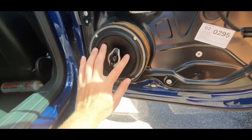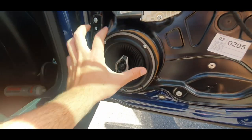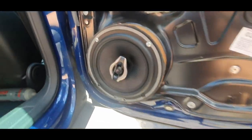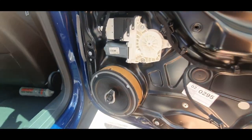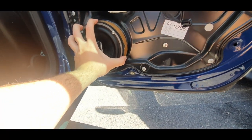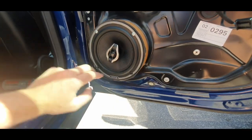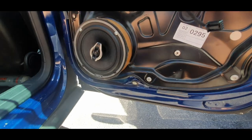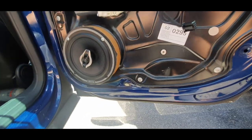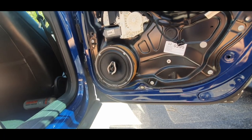I can't see anything physically wrong with it. I do have a speaker baffle on there — it's a sponge-like cup that sits behind the speaker and protects it from any water that might fall down when you put the window down in the rain. But speaker baffles restrict a lot of the airflow which you need to produce sound, so I'm tempted to cut the bottom of the baffle off to let some airflow through. It'll still be protected from above for any water.